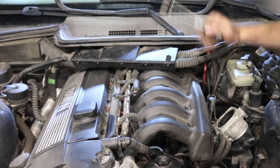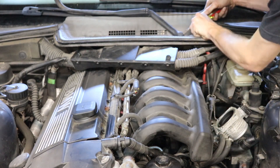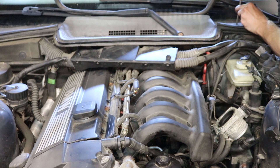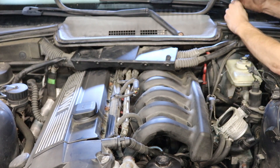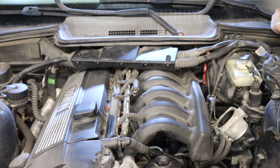After looking at this for a bit, I've determined taking this whole thing off is the best way. So we're going to start by removing the windshield wiper and all these plastic screws — looks like there's four of them. We'll take the whole rain cover off and then the heat shield that goes into the interior. Looks like we have to take both windshield wipers off.